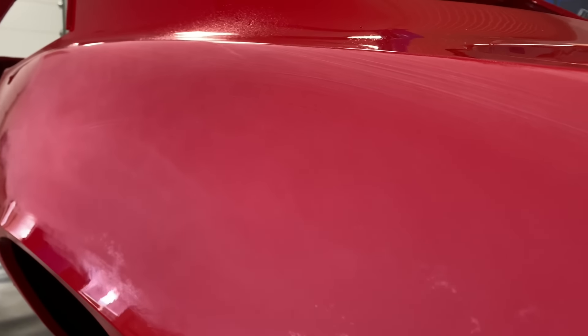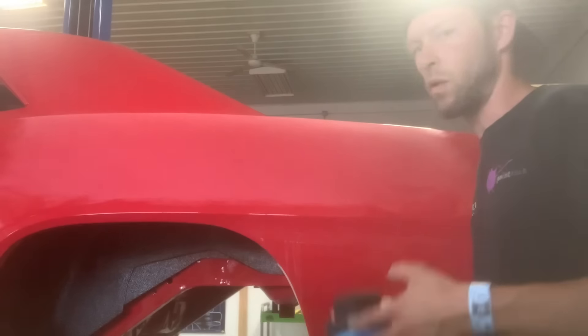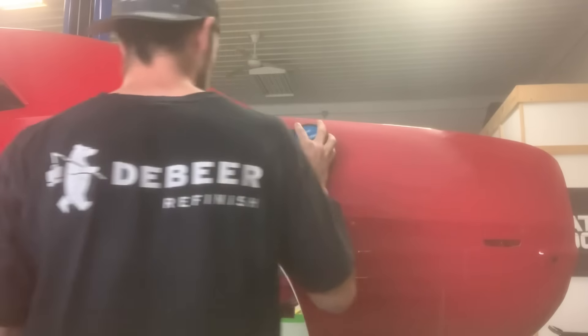So now on the driver's side, we hit this with a foam rubber type block. This says that this area is straight — there's no visible peel left in the sheen or the shine, as there is in this area where I stopped sanding. You can see the peel there, and you can see that it's sanded out in this area according to this block. So now I'm going to take a dry powder guide coat and rub it into these scratches.